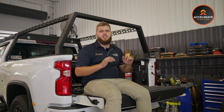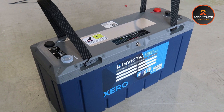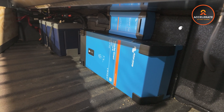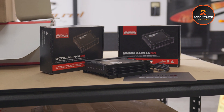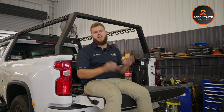So we've managed to make this as compact as possible. To achieve this for this client, we've put in a 200 amp hour Invicta Zero lithium battery, a Victron 2000 watt inverter, the new Redarc 50 amp Alpha DC-DC charger, as well as a little 15 amp Victron 240 volt charger just for maintenance when the car's not being used. I'll run into detail about each of those components and why we've chosen them.